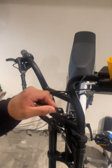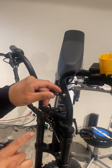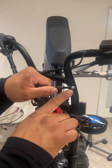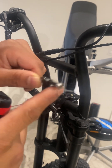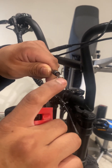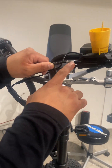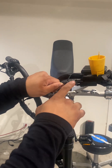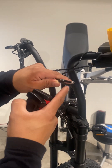Hello everyone. I'm going to show you how to replace the olive and the barb from a hydraulic brake on a pedal electric. In this case, as you can see right here, this is defective — it came cross and it's a little bad from the end over here. What this is doing is causing the brake to leak brake fluid when you press the brake, it comes out right here, just because this is not perfectly straight — it came out on the side.